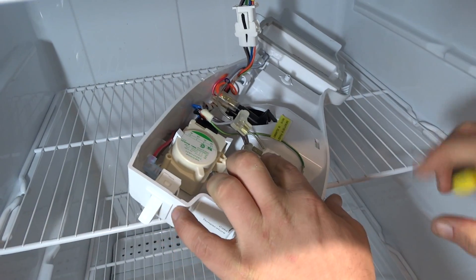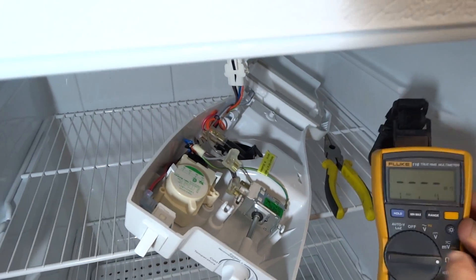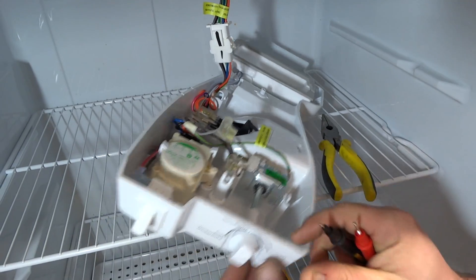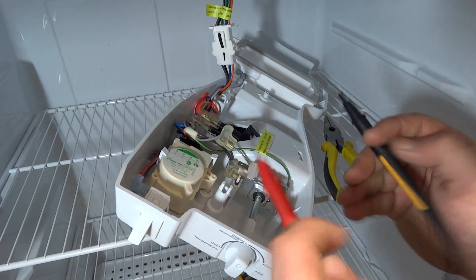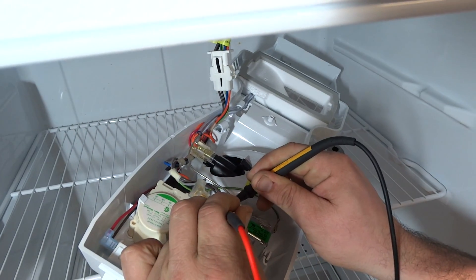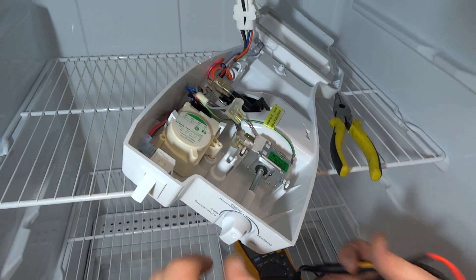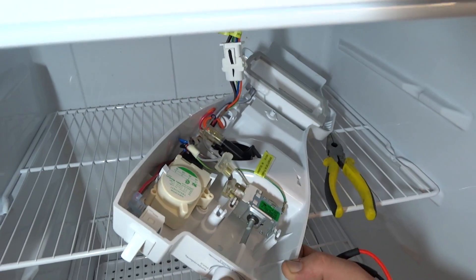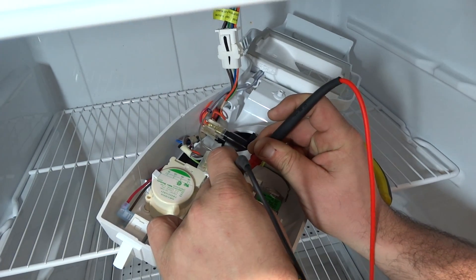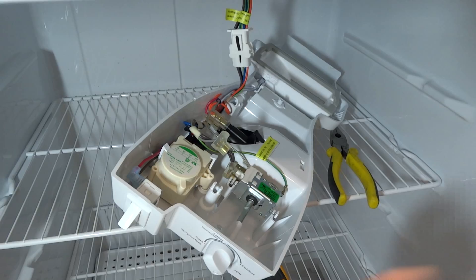Once you've got one terminal exposed and the other one down here, you want to use a multimeter if you have one — if you don't, it's not going to be easy to test this. Put your multimeter to ohms or continuity; either one will work. Right now it's in the on position, set to the colder setting, so it should read zero. And we are at zero on ours — that's why you hear the beeping. If you have it open or OL, that's a problem. Then test it the other way: turn it all the way to off. At this point it should be open. If you have continuity here — meaning zero or some low number of ohms — that's broken. That would be something that would keep the refrigerator constantly on.